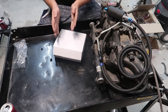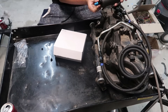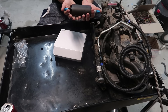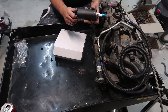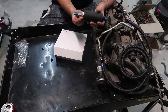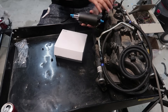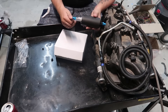I'd rather be closer to the tank than closer to the intake because these things don't suck — they pump. Hopefully gravity will get the fuel to the pump from your tank because it should be mounted a little bit lower than the tank. They're not great at sucking, they're great at pumping. The positive and negative studs face towards the intake. I try to keep these really close to the gas tank and then that's usually enough to siphon the gas from the tank and pump it out at 255 liters per hour.